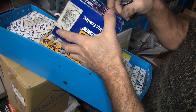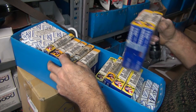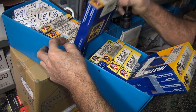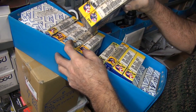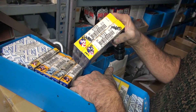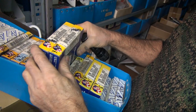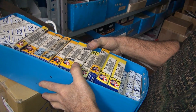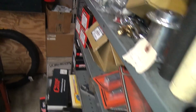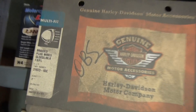See, these are sold per piston, not per motor - see how they're taped together. I think every single rebuild I've done with you we've had to file them down - they're always 10 over. How much filing are you going to have to do? 10 thou. 10 thou times pi - that's at least 30 thou. Or you reuse the ones you got, which are probably just fine, because they're probably broken in. You can make a decision which way you want to go.